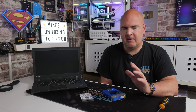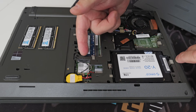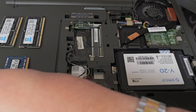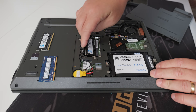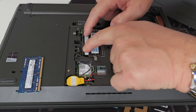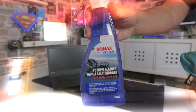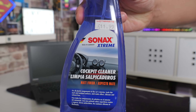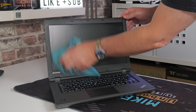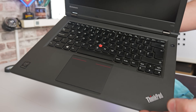Overall it's a very nice system and runs surprisingly well considering it still only has four gigs of RAM and that older Intel i3 processor. It's a lower-spec ThinkPad so we can't expect miracles, but putting the SSD drive in has made it much more usable. I'm now just waiting for the RAM to arrive tomorrow — super easy to install, just remove the back panel and push it in. We've effectively revived this laptop from basically unusable to usable for at least a few more years, at a pretty reasonable price of around £60 all in.